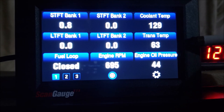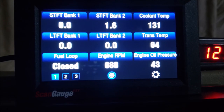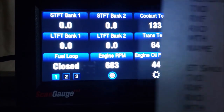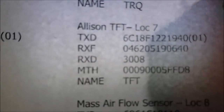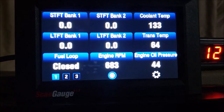Right here we've also got our transmission temperature for the Allison five-speed. At the moment we still can't pick up the temperature on the Allison six-speed, but if you've got a five-speed this will automatically pick it up. Now on the old ScanGauge 2 — that's the old one right there — in order to get a lot of that data like transmission temperature, you had to manually put in all these long string of codes by hand. With the ScanGauge 3 you just let it do a scan and it picks up all that stuff automatically for you.